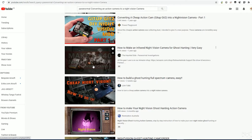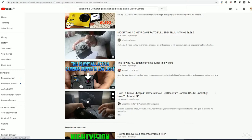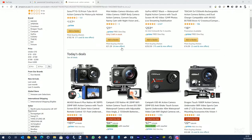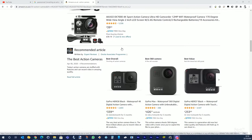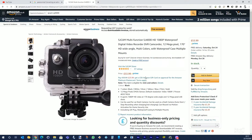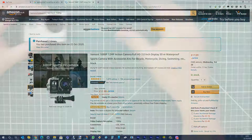However, there is a filter built into the lens that blocks infrared light. Ghost hunters simply swap out the lens altogether — albeit it's glued in — but doing this renders the GoPro near useless for daytime recording. So rather than destroying my own GoPro, the great news is there are plenty of GoPro knock-offs which are cheap but have the same infrared-capable sensor built in, and the IR filter can easily be removed from the lens. These include the SJ Cam SJ4000 for around 60 to 70 quid and the Vermont 1080p. I found the Vermont on Amazon for £17.99, took a punt and snapped one up — worst case I break a cheap camera and it's no great loss.